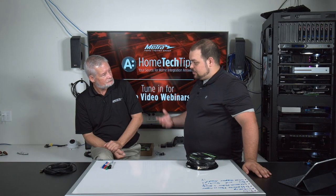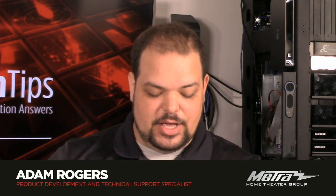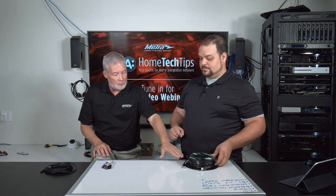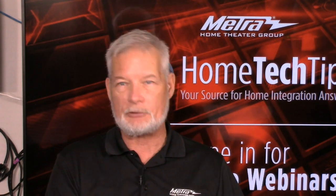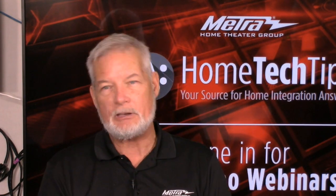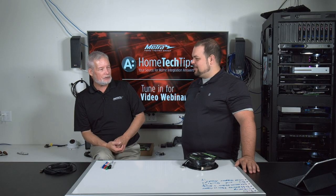So one of the biggest differences, of course, that we already touched on, is the fact that you're running fiber. With fiber, you're not having to deal with any kind of electromagnetic radiation that's going to cause issues. And on that note, by the way, that goes both ways. Frequently, the HDMI cable can cause more problems to the rest of the world than the rest of the world can to HDMI. One of the big advantages of fiber is you do not have radiated electromagnetic information, so you're not going to affect your IR system or your control system. If you buy a cheap copper HDMI cable, for example, you can absolutely kill your remote control system because it will radiate more noise than the system can segregate from the signals. That was RTI, wasn't it, or URC that ran into that? Both of them.